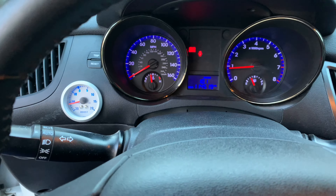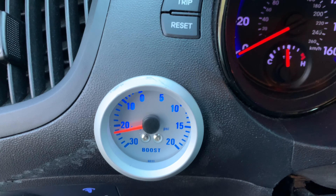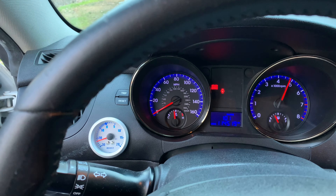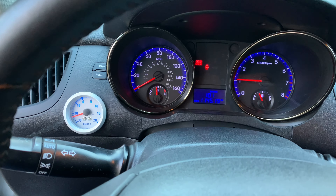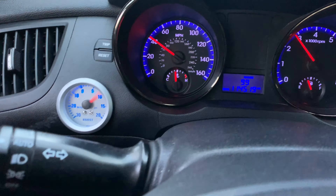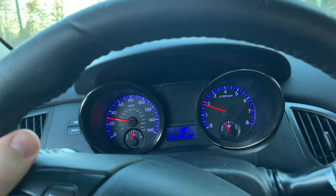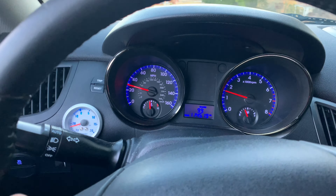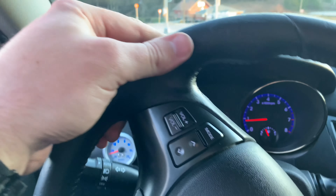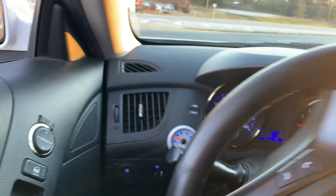All right guys, it's been warming up for a little while, so now it should be good. All right, let's see what it'll do. Check this out. So 12 pounds was about normal. And when I hook up my OBD2 scanner and everything, the gauges on it shows boost pressure right at 12 psi and then drops down to like 11.6 or something like that when it gets full boost. Right then, when I first got on it before I started zooming, it was going like 14, 15 pounds because it was just cold. So we'll see what it does this time.